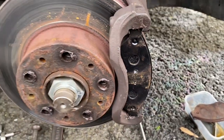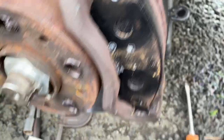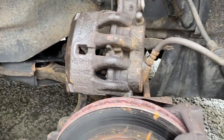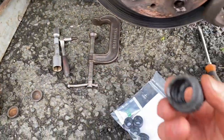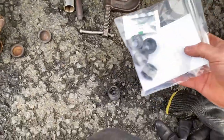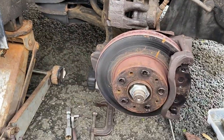What I've done is I've taken out the brake pads, replaced them with new ones with a bit of copper grease in the bottom, cleaned all the discs, filed all the discs down, taken the sliders out of the caliper and cleaned all the sliders. The reason for the issue was one of these gator boots was missing. These stop the dirt and stop the grease getting into the sliders, so I've bought some new ones and I'll put all this back together again now.